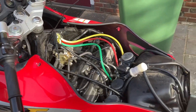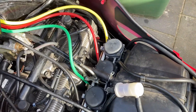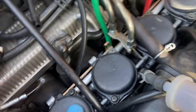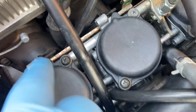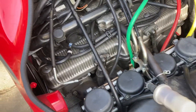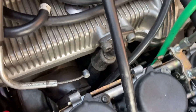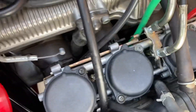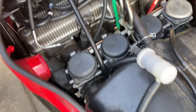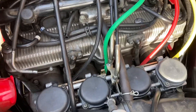The engine has been warmed up and now I've connected everything — got the fuel source to the bike running and hooked up the devices. In this model they already moved the sync port from the top of the carburetor to the lower side, so it gave a little bit of trouble to hook up the device, but it was still doable. Now I'm going to start it up and check on the monitor how things are running, and with these screws I'm going to adjust the carburetors to get them in balance.